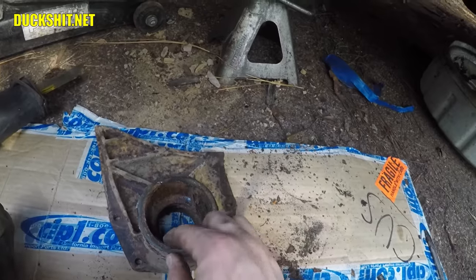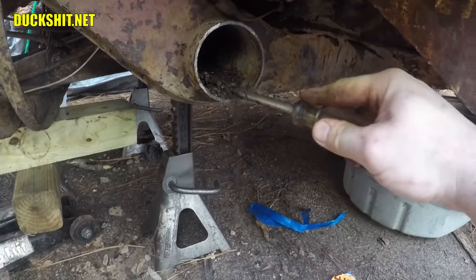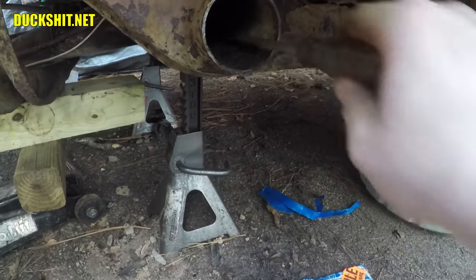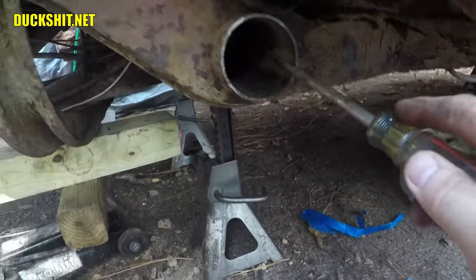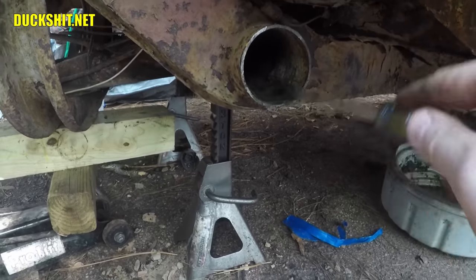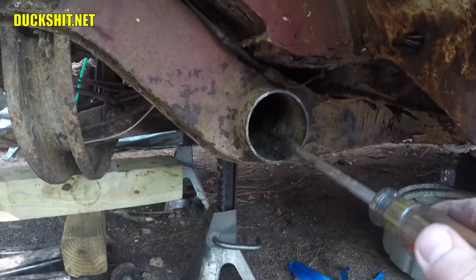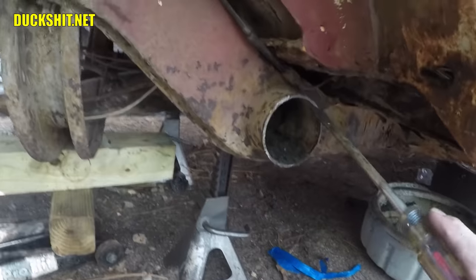From my understanding, if I manage to drill out the welds around this I can cut that off and it'll slide off, hopefully as easily as this thing came out. Inside of here - look at all this - this is just rust. This is the reason why my torsion bar was all rusty. It's disgusting. When I get the other side done I'm actually going to rinse through this with some water and then spray in some oil to chase it and try to get as much of this dirt and stuff out as possible. I'm wondering how it got in - whether it was just on the ends or if there's actually a hole somewhere up on top.